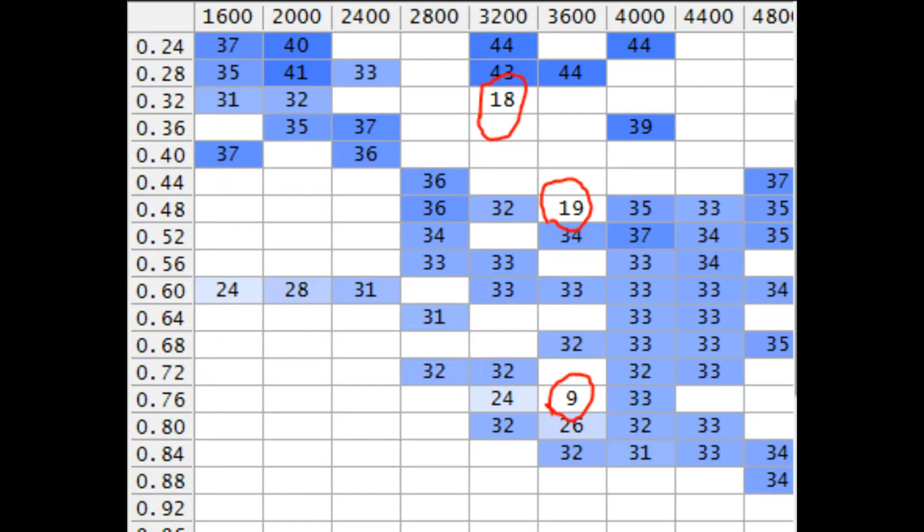The only thing that I could see in the log, the throttle position sensor, it looked good with the exception of sometimes when you floored the car, you could barely even see it. Instead of going 0 to 100, it'd go 067 100 or 070 something in 100. So I'm going to replace that too. But yeah, these timings circled in red, they should not be that low. There's something wrong there. So again, that's why I suspected the crank position sensor.